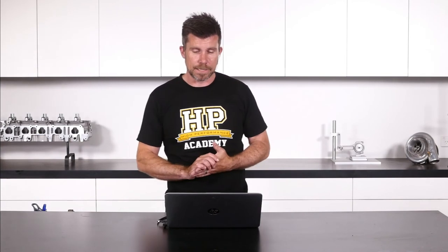Cars bars and guns asks about best practices for grounding shielded cable shields. This is straightforward: with a shielded cable you only want to ground the shield at one end — the ECU end. The shield will generally be grounded internally inside the ECU or to a ground pin at the ECU, as documented on your ECU wiring diagram. Don't ground the shield at both ends — that's the worst thing you can do. While grounding only one end creates a partial antenna effect, the shield is still doing its job of draining electromagnetic interference away from the conductors inside.